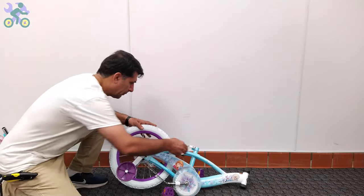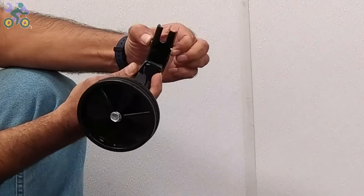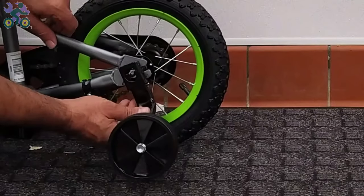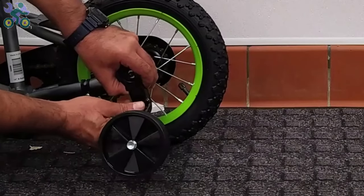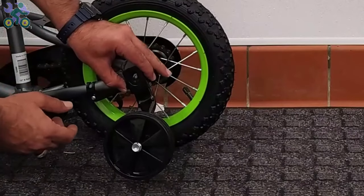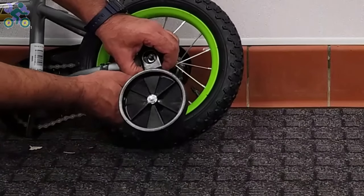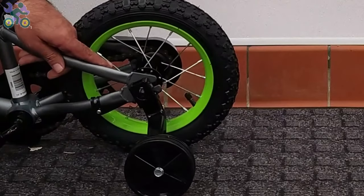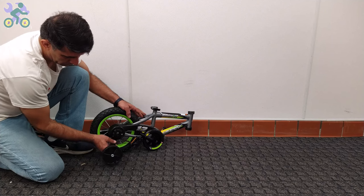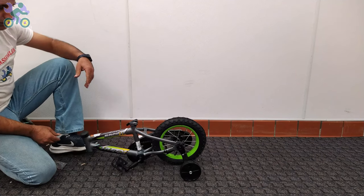The training wheels on this bike model are not adjustable. Some people ask whether training wheels should be in full contact with the ground or have a certain distance from the ground. Training wheels, also known as balance assist wheels, are designed to help children learn how to balance while riding a bike. If they fully touch the ground, children may not learn balance; if too far off, children will always feel like they're falling. The recommended clearance is approximately half a centimeter, or one wheel touching the ground with the other about one to one and a half centimeters above. Training wheels without adjustable settings usually come with this preset distance when installed.